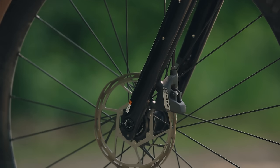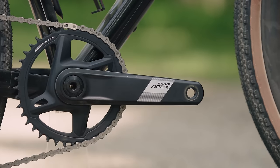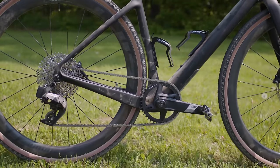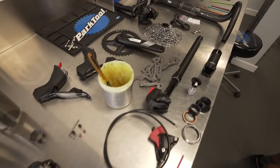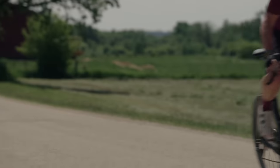Onto the brakes — the calipers follow the same design as the latest Force AXS brakes, with re-profiled internals and a new two-piece body. The performance and feel are very familiar, but what was most notable was the lack of any rotor scrape. Even after many hours in the saddle in hot, dry, and dusty conditions, the wheels turned smoothly and the braking remained quiet throughout. The chainset is practically a carryover from Rival AXS 2 — the matte finish with laser-etched logos may not look as premium as the high gloss of Rival, but under its skin it's the same unit. I'll be getting more time on both versions of SRAM's new Apex, so watch out for my reviews on BikeRadar.com very soon. We'll also be putting each component on the scales — make sure you're subscribed with the bell icon ticked so you see it before anyone else. If you want to know more about the latest SRAM Force groupset, why not check out this video?